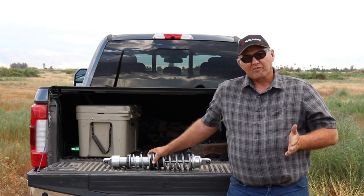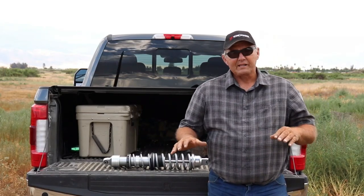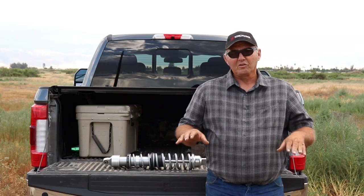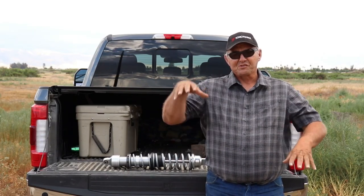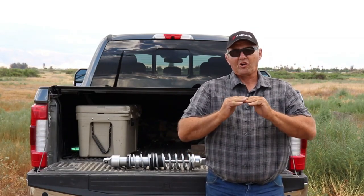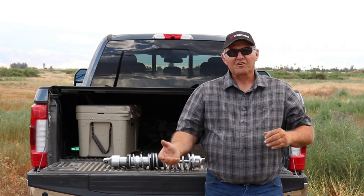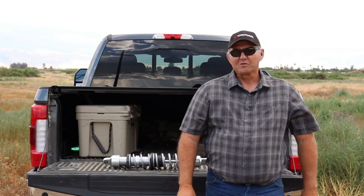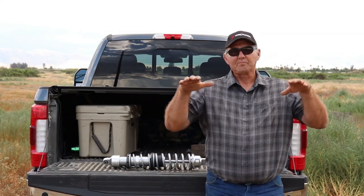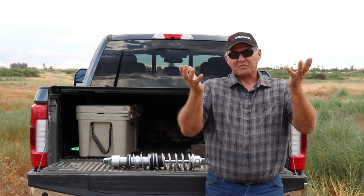So I went ahead and went that route, and Reed was right. My car rides great. Now when I'm in rough terrain, before it shook the car all over the place, such as a washboard trail or whoops, now the suspension soaks up all of the impact of that terrain and the body of the car stays level. So I'm feeling very little, but you can look out the side of the car and see that the suspension is working, which it didn't before. Because it wasn't a dual rate spring system in the past, when you took an impact, the car body went down with the impact. Now the suspension comes up underneath the car.